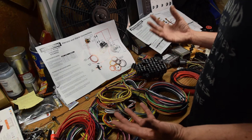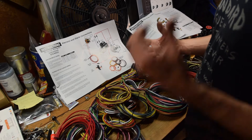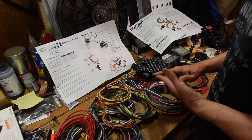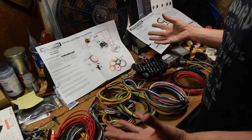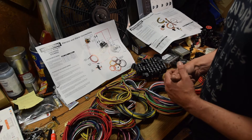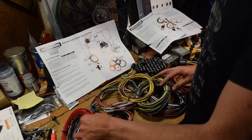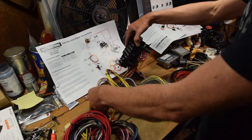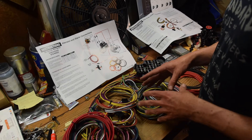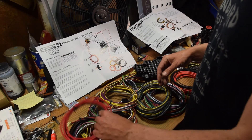One of the things that was kind of fuzzy to me when I bought this kit was how the Speedway harness connects to the LS harness. Really there's only a handful of interface points and then the rest is two independent systems. You've got a chassis harness — you supply your power and ground to essentially the LS harness and then that's its own standalone thing. This kit comes with a relay hardwired in, and the LS kit also comes with a few relays hardwired in. I'm not going to be using those — I want a dedicated relay box in the engine bay. I don't want random relays and fuses mounted in different places, so we're going to centralize all of that.